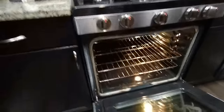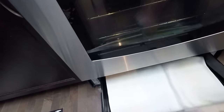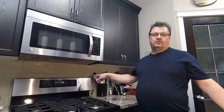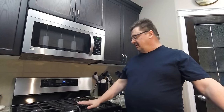Now we are going to be working inside the oven, and we'll have to take out the bottom tray, take out all the racks as well, and we're going to pull out the warming tray here. That's where the connections are on this particular model of Samsung stove or range. Others have a panel on the back that you'd have to pull off to get to the connector, but ours happens to be within that drawer, so it's a little bit handier. Now the first thing you want to do, especially when dealing with any kind of electrical appliances, is you want to unplug the AC power side of the range.